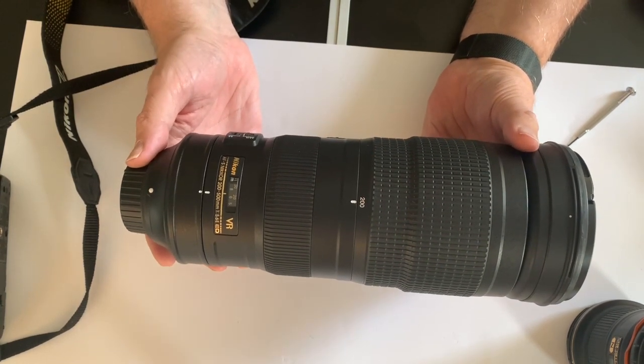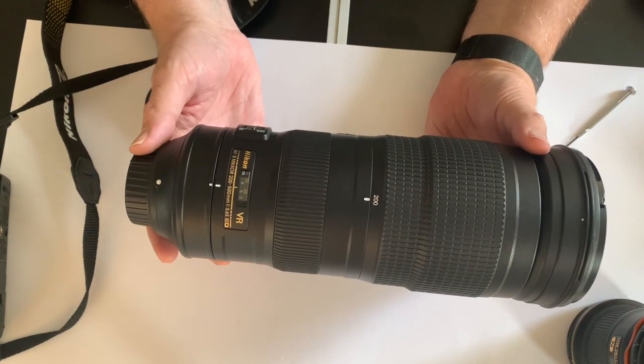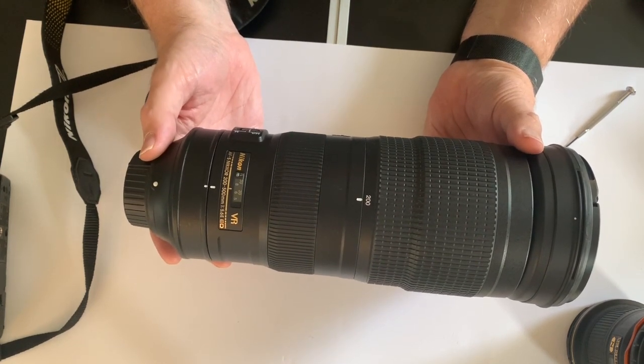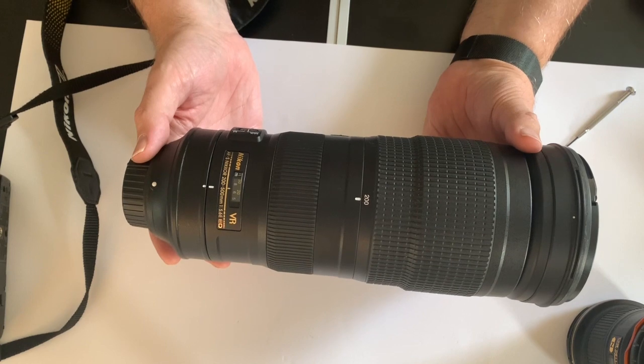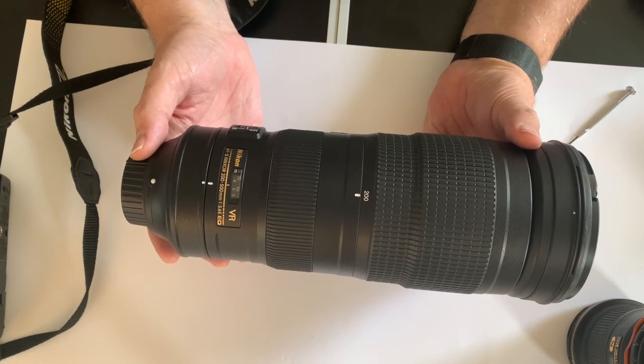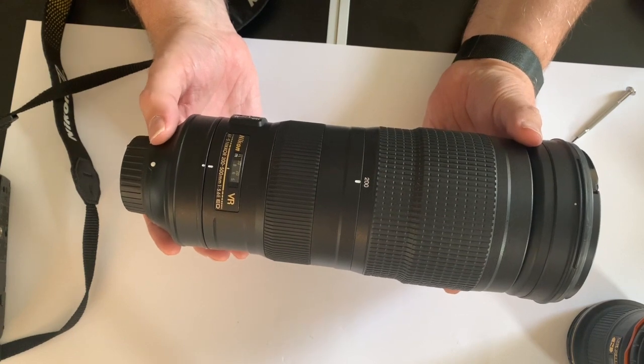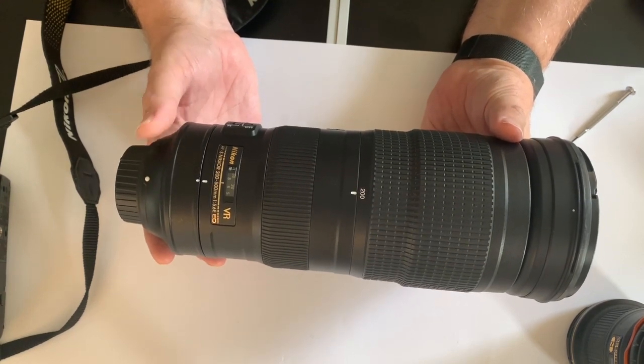And in my experience, when you take a lens off a body and power down the body first, the aperture locks down at the minimum size, maximum F number. So that's the opposite of what you want for astrophotography.